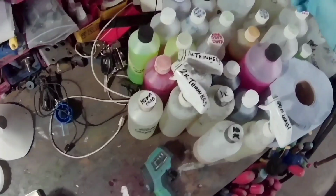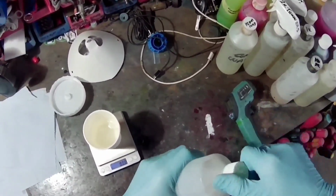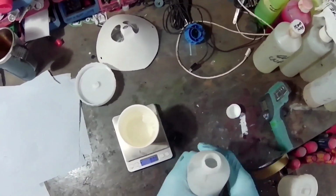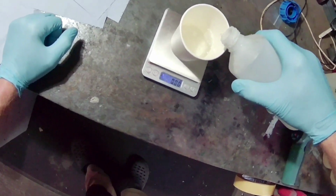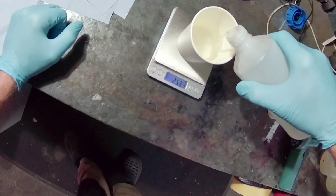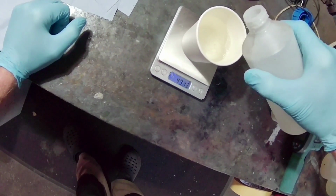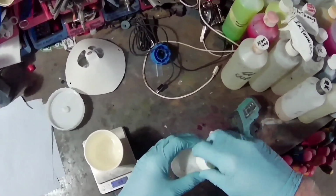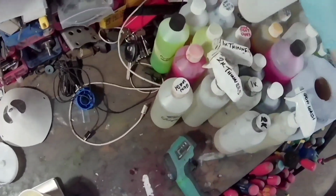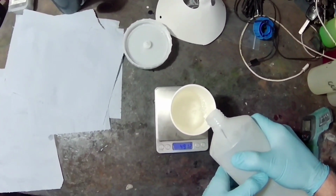As I was saying about using the MM2, because it's a clear that actually runs out quite nicely, you only need a relatively thin film to get that flow out. And because both of these don't put out a lot of material, by full-size gun standards, or by a lot of minigun standards, it means that you can get a nice thin film of a better quality clear coat, or an easier flowing clear coat, and get really good results and save materials at the same time.